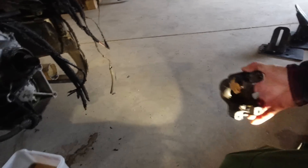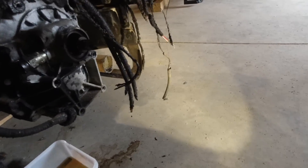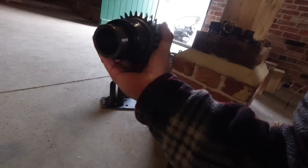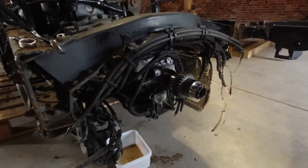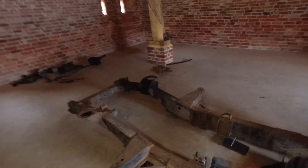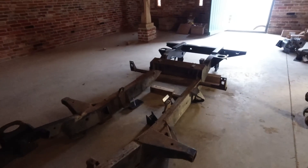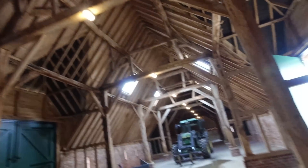This is the coupling for the lorry prop shaft that was on the output shaft - I've taken that off. I've got this gear from Rhys Myers to put in the Land Rover transfer box, and that's going to match up straight on there. So the transfer box will be driven by the lorry gearbox - I think it's a ZF five-speed. Because this is a TD5 chassis, I'll get some TD5 rubber mounts and then those brackets should bolt straight onto the TD5 mount. The lights are pretty shocking in here, hence the Milwaukee LED light shining over the top of the engine.